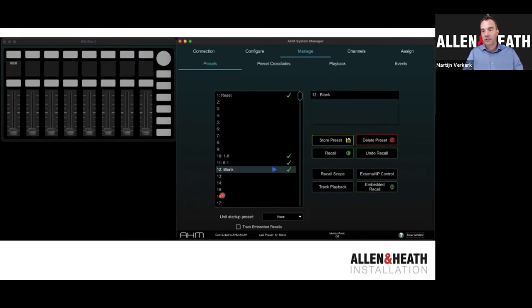So why would I do that in a configuration? Because if I do it in a configuration, I can also make the choice to change specific items in my DSP, which could go together or maybe completely do not go together. And turning off a physical controller is possible, but in our case, we just unassign all the functions of that controller and it looks to the end user like the system is off.